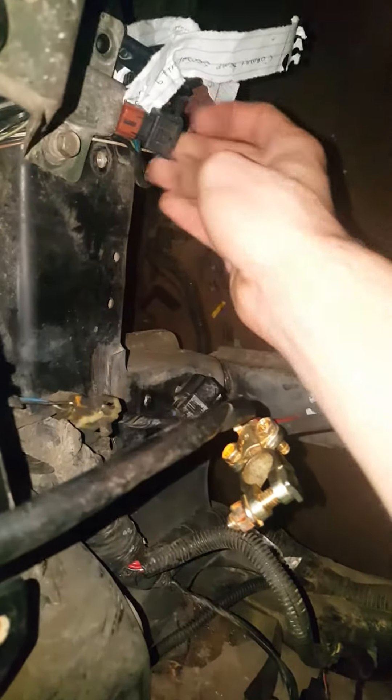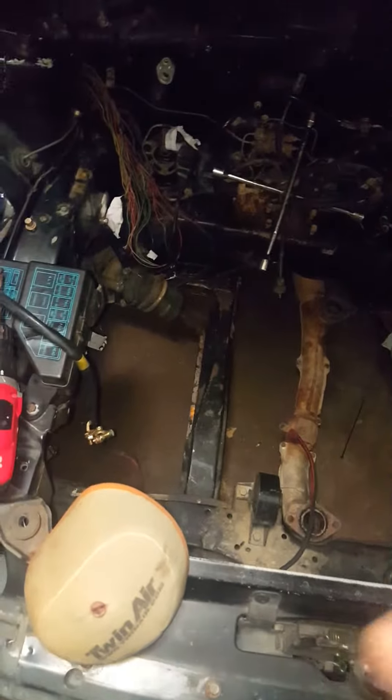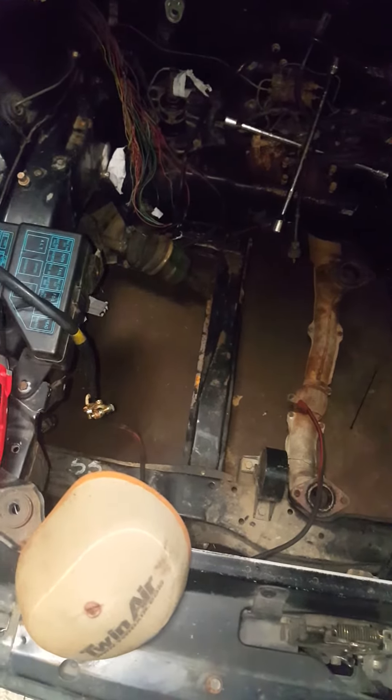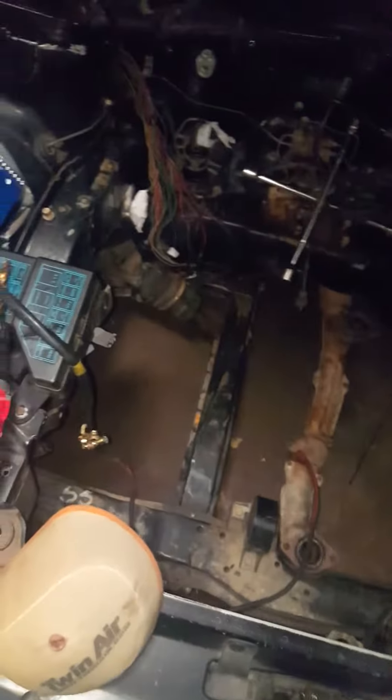You've got your coil pack stuff, your PTU, and the coolant temperature sensor stuff. The coolant temperature sensor is only about right here. I'm going off memory because I don't have a good engine sitting in here to see exactly where everything goes, but if I extend it too much I can just bundle it up and tape it back into the harness.